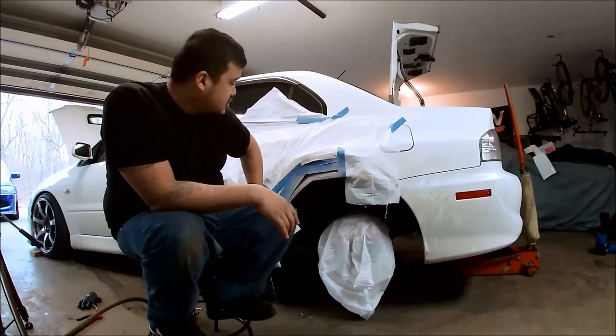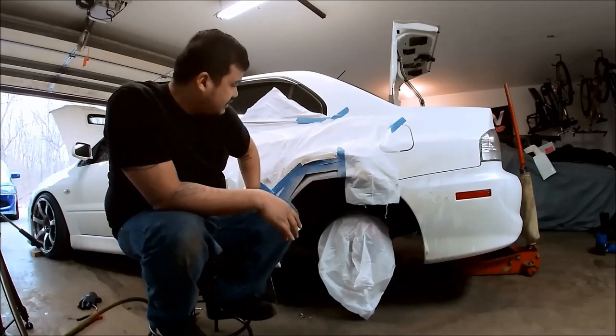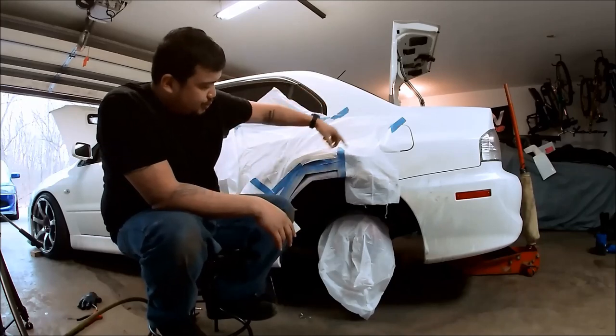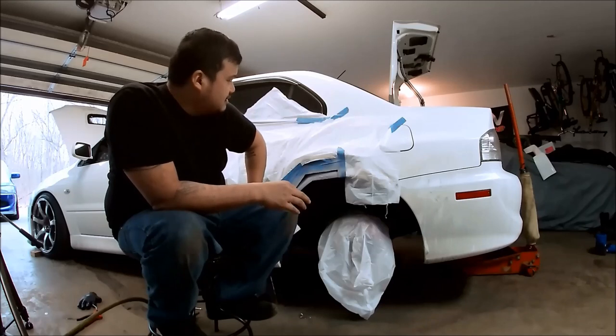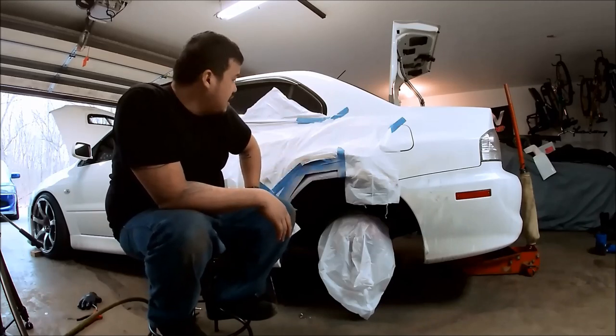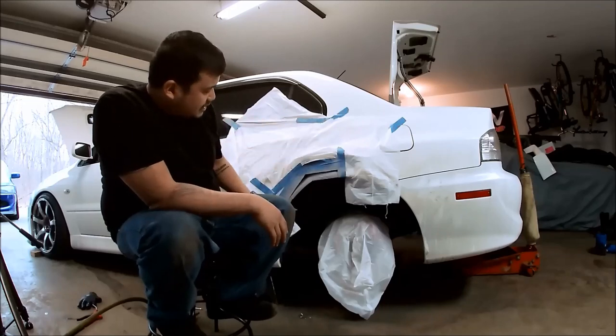Along with the patch that we just made, primer sealer is probably good enough to protect it inside. I went into the trunk and sprayed in there too. Maybe we'll do some cavity wax in there if I can go get some, if we ever get out of this quarantine. So next thing we're gonna do is remove the mask, and then we're gonna take the cardboard